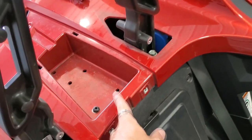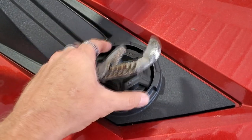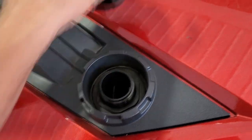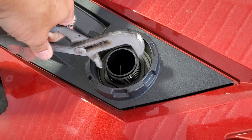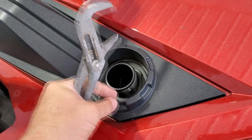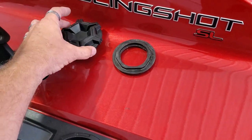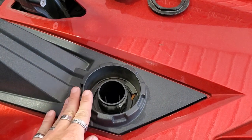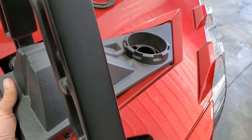Now we're going to put our new pod here. On this side, you're going to take off the gas cap and set that over here. Then you're going to take some channel locks and remove the lock washer that's in here so that you can take it off to get this piece out. We've removed the collar off of here and the gas cap off right here, so we're going to take this piece off and replace it with the new one.